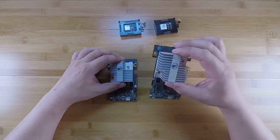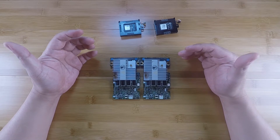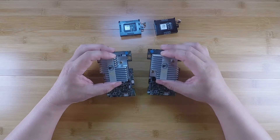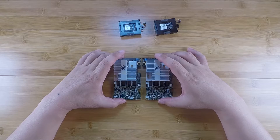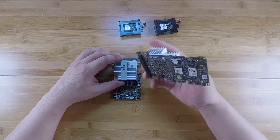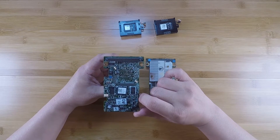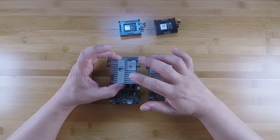I don't know what makes this card so different, because from a hardware perspective they're both 2208 chipsets, they're both labeled as H710s from Dell, and they both work perfectly fine in Dell servers. So I just wanted to share that information. If you're up for the challenge, you can try the MCR5X card — I've had no success with it — but I now have a stable process to flash the 5CT6D and can consistently produce these as IT mode cards, and those are what I sell on my eBay store.